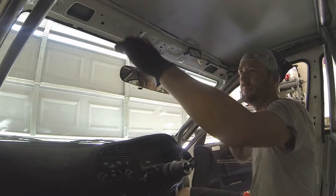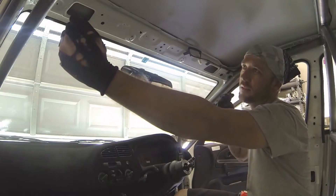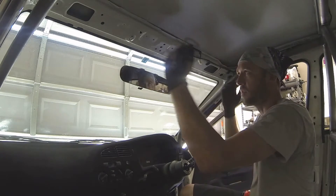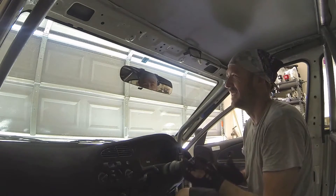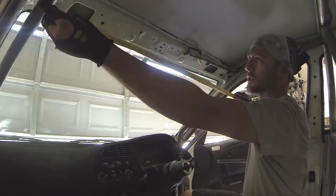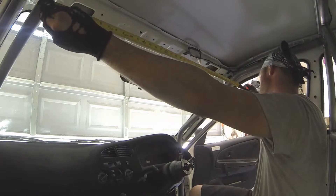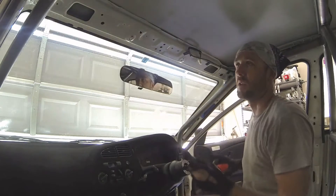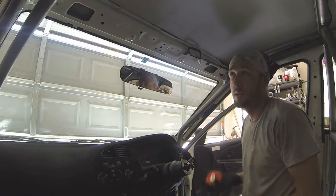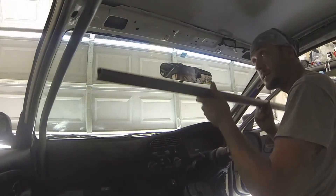Every now and again, if the forward hoop sits a little bit low, we'll put a little bend on each end of it to try and mate up with it to keep it out of the driver's field of view. But since he's sitting pretty low in this one, I'm just going to run straight across. I'm going to take a measurement here — the tube looks like I've cut a 38-inch tube, notched on both sides, and then we'll have a windshield bar. It's really that easy. Sometimes the simplest designs are the ones that you've got to use.